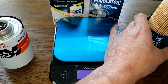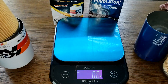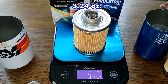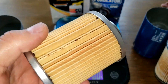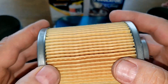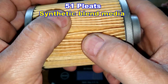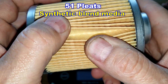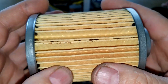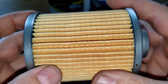Now for the filter media. The Purolator 1 filter media weighs 95.2 grams and the K&N weighs 91.9 grams. Starting with the K&N: it has a glued inside seam, metal end caps, and I counted 51 pleats. It's supposed to be a synthetic blend media, but I couldn't find a micron rating for this filter. The pleats are nicely spaced, with just a small gap at the seam, which is usually the case — otherwise they look good.